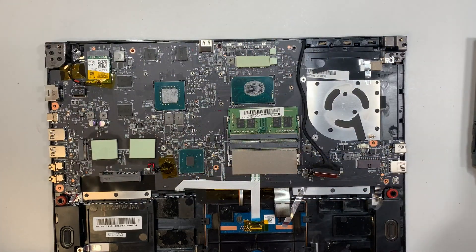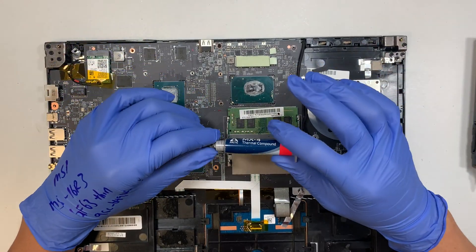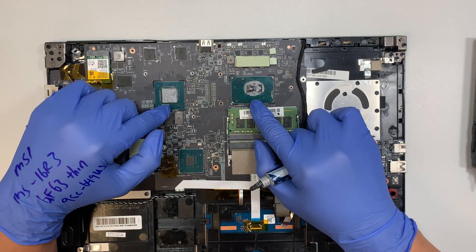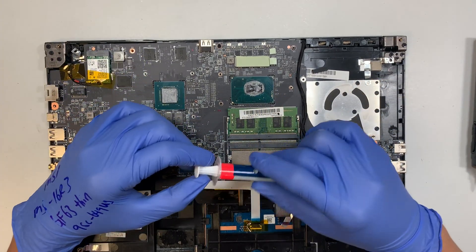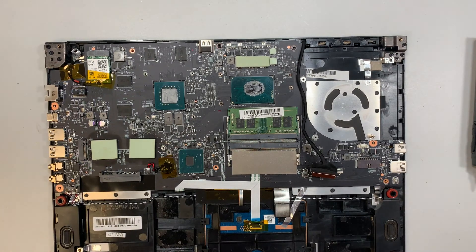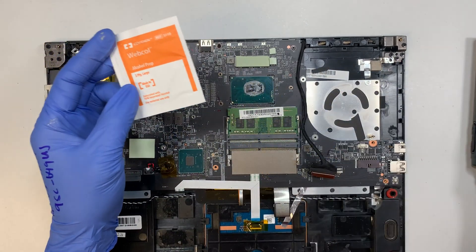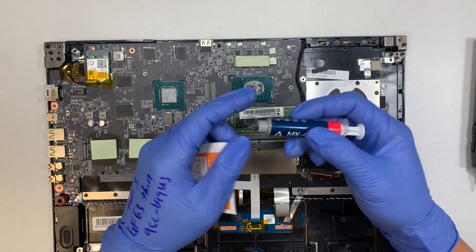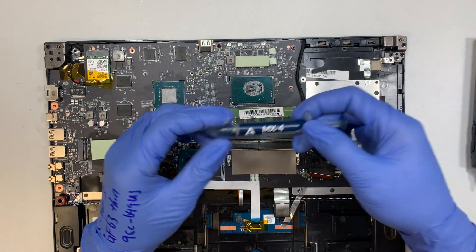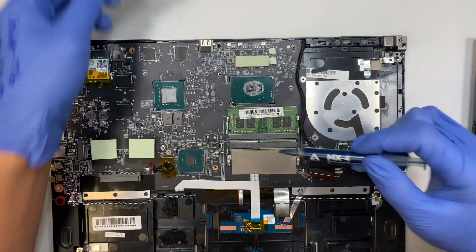Now if you have a temperature problem — if the computer is getting really hot, or the fan runs at high speed with buzzing noises — it's time to check the thermal paste. My thermal paste is all dried up after slightly over a year. You can see it's dry, not moist anymore. What you want to do is get some alcohol wipes and wipe it down. Once you wipe down the old thermal paste, apply new thermal compound. I'll have all the links in the description below — clicking those links directs you to Amazon or eBay to find replacement parts.